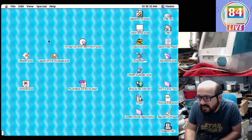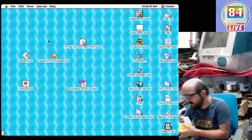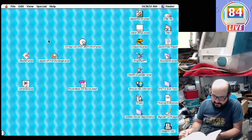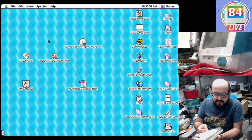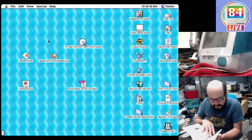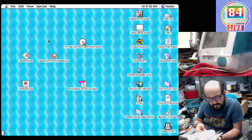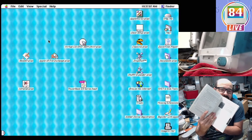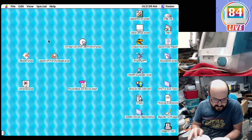Yeah, so the iMac does not do IR talk, it does IrDA. And the PowerBook 2400 and the early PowerBook G3 actually does both. I mean, it could be that this Kodak camera is not using IrDA. It might be using something proprietary. I don't know. Actually, no, it is using IrDA because it actually says here IrDA 1.0. Yep, so that's what it says in here. So it is using the IrDA standard. So IRTalk would not apply.